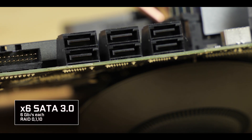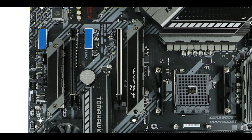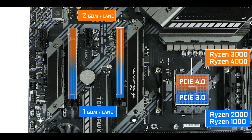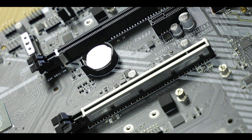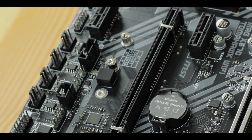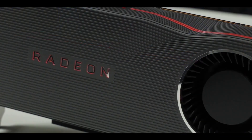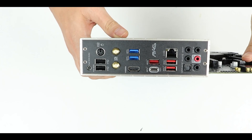In the storage section we also have the usual six SATA 3.0 ports, spaced out for easier access. Expansion-wise, we have four PCIe slots: two x1 and two x16 slots. Only the x16 slot closest to the CPU can run up to 16 PCIe lanes — that's where you want your GPU for optimal performance, hence the metallic reinforcement. The second x16 slot is capped at four lanes, so not really suited for GPU-intensive tasks. We don't yet have video cards that can fully exploit PCIe 4.0 bandwidth, but it's great for future-proofing.